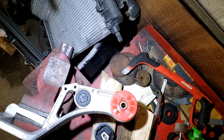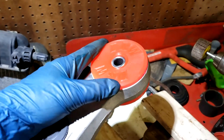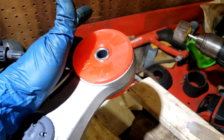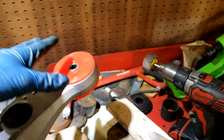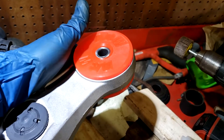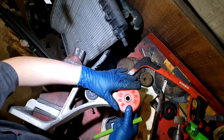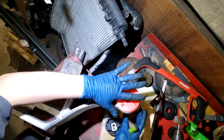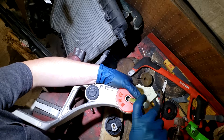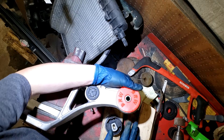I normally make these mounts out of 70a shore hardness polyurethane. 70a shore hardness is pretty good for a daily driving car where you just want an upgrade from the factory rubber. If you want something more firm - like an 80a or 90a, for when you don't care about engine vibrations and just want the most firm mount possible - I can make that. This one is a little more firm than the factory one, but the way this bushing is made with two halves, when it's not bolted in the bushings want to move out. Once it's bolted in it'll be nice and solid in there.